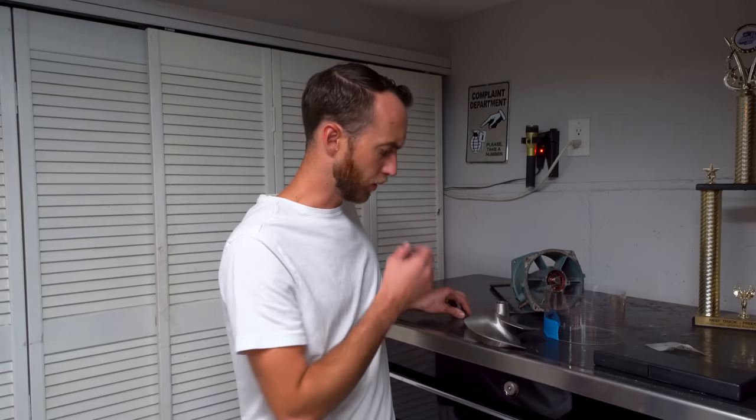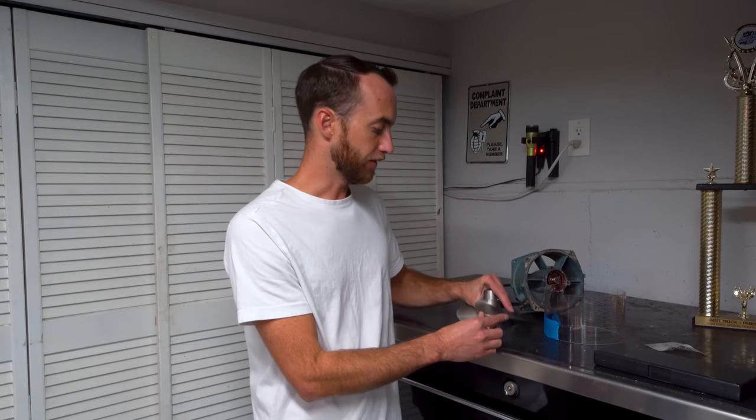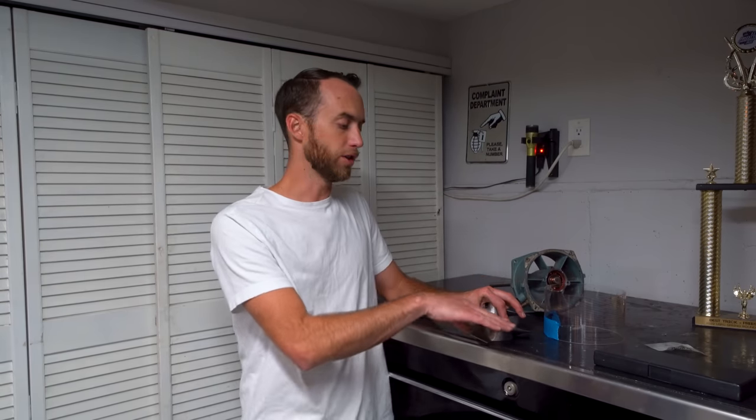So what do the leading and trailing edges actually do? The leading edge — the first inch and a half or so — is what more or less affects the bottom end of your jet ski right off idle: how quickly it's going to rev up. If you're overloaded, your jet ski is going to feel really sluggish all over and just won't come to life. If it's too loose, it's going to feel like you have a bunch of weeds in your impeller — making a lot of noise but not going anywhere. If your jet ski is really slow to rev up, the leading edge number is too high.